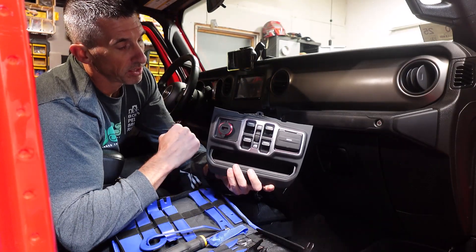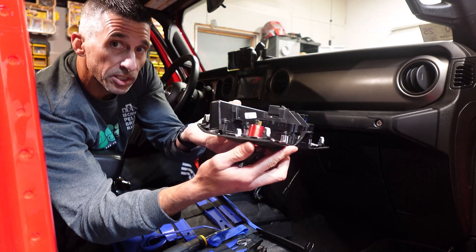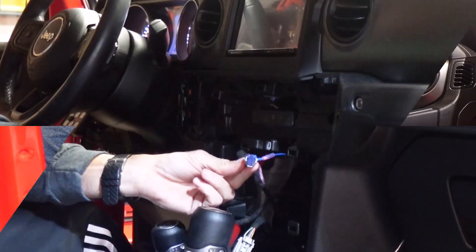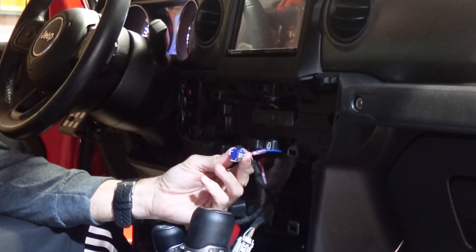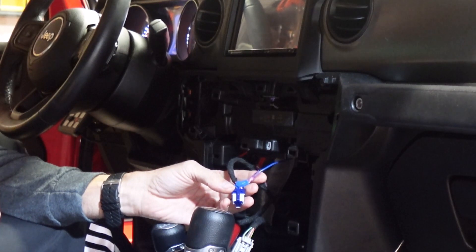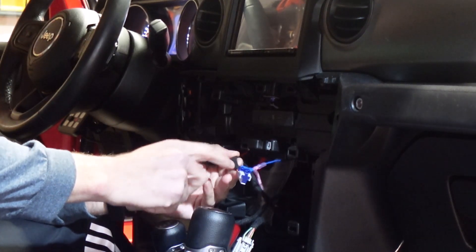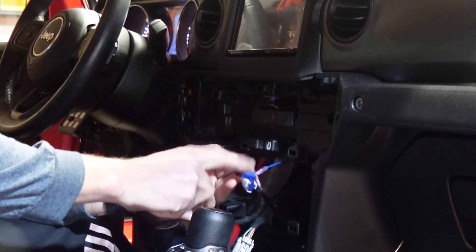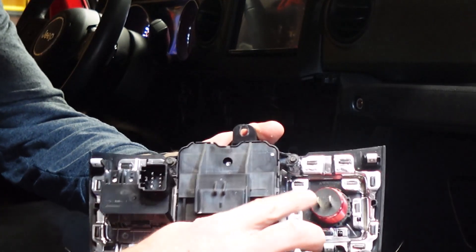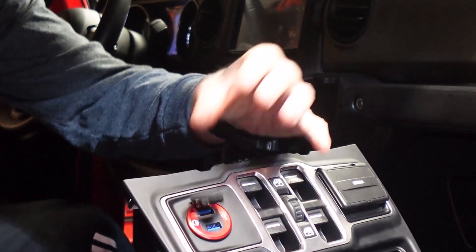I was able to take this USB port — which, if you can see it clearly, is threaded in the back — and screw it right in. It's a nice, clean fit. This plug right here is for the back of that 12-volt DC plug. The previous person wired the remote-on for the radio to the power of this plug. I want to preserve this plug, so what I'm actually going to do is bring this wire wrap back, put in two wire taps, and tap into the positive and negative on the back of the plug. That will make this active and run all my devices.